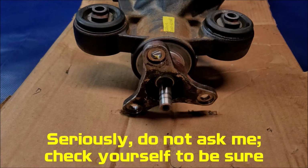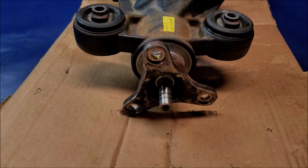I've had a lot of people ask me about swapping over the flanges, and yes, this is something you can do. However, it is a lot more complicated than simply unbolting one part and putting the new one on, because the clearances on these differentials is important, and you need to have the right amount of preload for everything to sit properly. I just don't think it's worth undoing the parts and trying to swap them over on a diff that is already functioning perfectly fine. I think it's a lot better idea to wait and find the differential that matches your car.